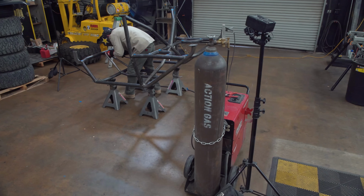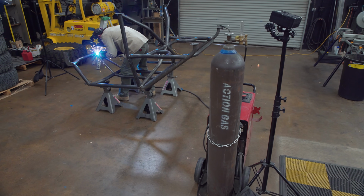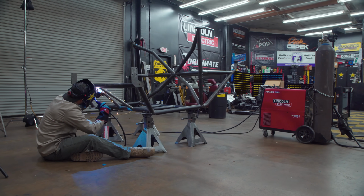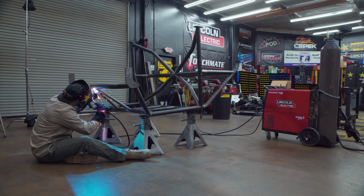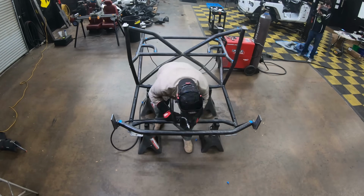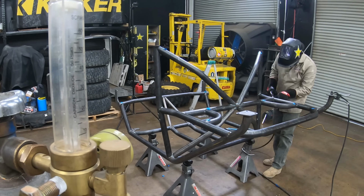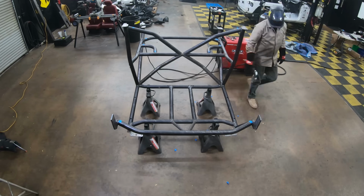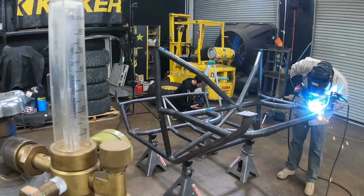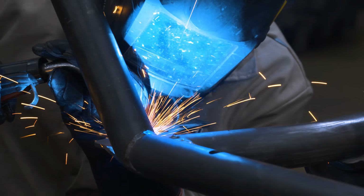Mark wanted something a little bit custom on this, and obviously what we do here at the garage, we always try to throw little pieces of customizing in there. We added a fastback feature to this cage. Using all the same 2-inch DOM that Genright uses, we rebent some of the tubes from the B pillar back and built our own customized piece back there that still takes a Genright basket. We'll still be able to slide a full-size Dometic under there.